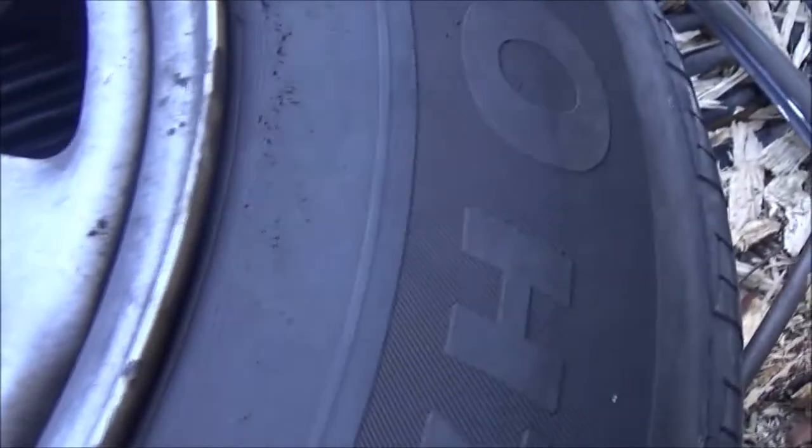So like I said, we're on our way. We stopped to get the tire first and then we're going to go get the bolts. This is why we're putting the tire on - well, it needed one anyway, the tread's not that great, it's down to the tread wear bars right there. But if you look at this dry cracking, it's a good way to blow out a sidewall. So we're just going to use this one for a spare.